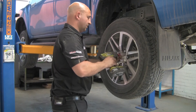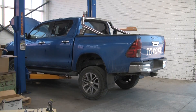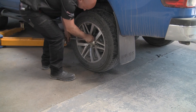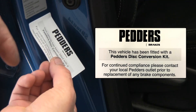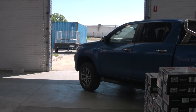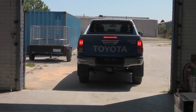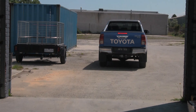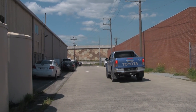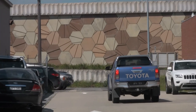Replace the wheels, tightening the wheel nuts in the correct sequence, then lower the vehicle. Conduct a final wheel nut check when the vehicle is on the ground. Apply the Pedders disc conversion kit sticker to the driver side B pillar. After all post-operation checks have taken place, road test the vehicle to bed in the rear brake pads, check handbrake cable tension, keep a careful ear open for any unusual noises, and make sure the rear braking system is functioning as expected.